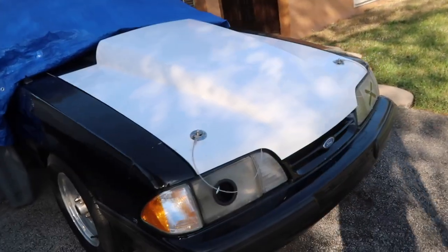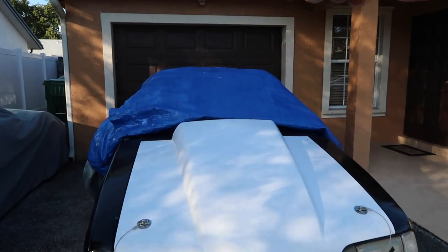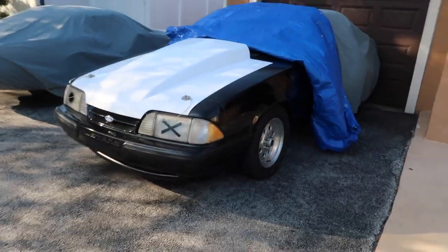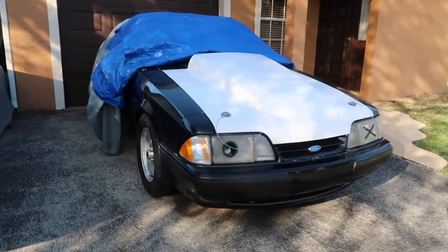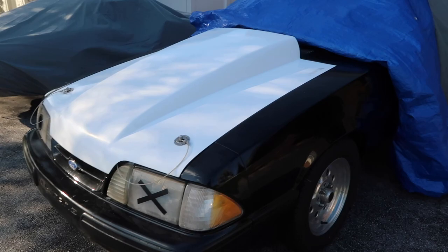I'm stoked on that. Now when we're driving and doing pulls, I won't have to worry about the hood blowing off. I'm not sure if the fiberglass hood would dent the roof like the steel hood, but it's just added insurance — and if you're building a race car, hood pins look badass. It actually came out way cleaner than the first time I did it on the OEM steel hood. Any of you guys can do it — just be patient, take your time, take a lot of measurements. Measure left to right, front to back, make sure everything is as close as possible before you start cutting holes in your hood, because once you drill a hole there is no going back. Hope you guys enjoyed the video — hit the like button, subscribe to the channel, and I'll see you in the next one.